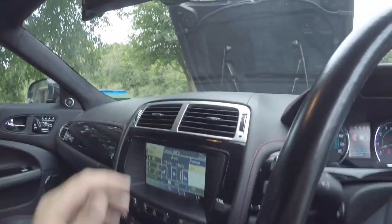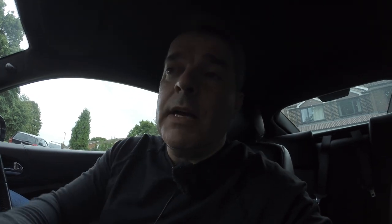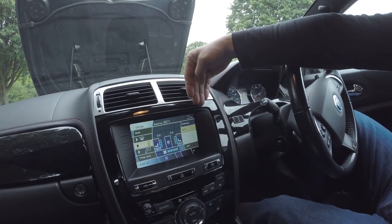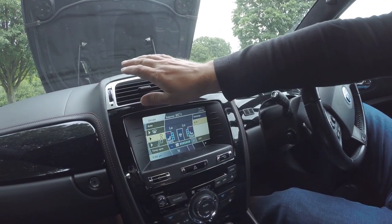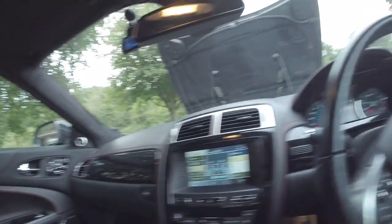Let's keep going. Go and check back in the engine bay. I think this is a function of a bit of an airlock in the system. This side is really cold, this side isn't — this is ambient. Arguably it's a bit cooler than it was, but this side is significantly colder. Same on these vents. The far vent over there, which is that climate zone, is fine, but this one isn't. So this works of a sort. I'll have another look out in the engine bay, see what I can do, disconnect the canister, see if that makes any difference, and we'll keep trying.